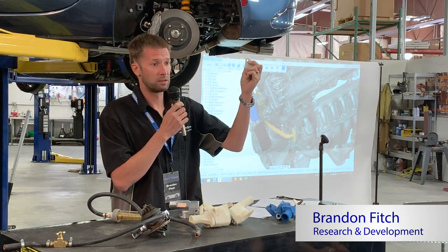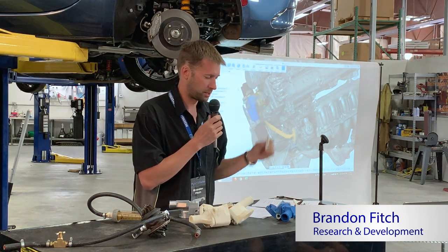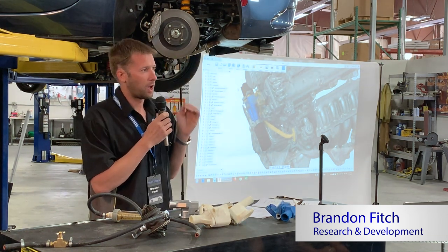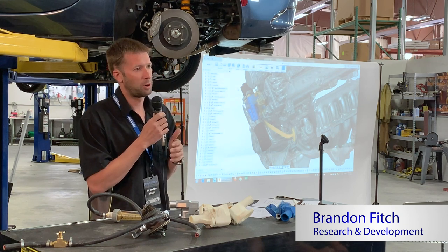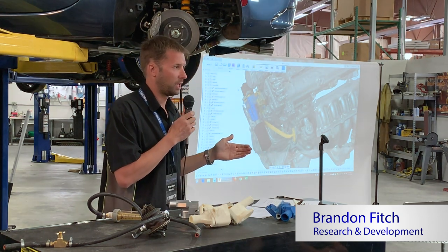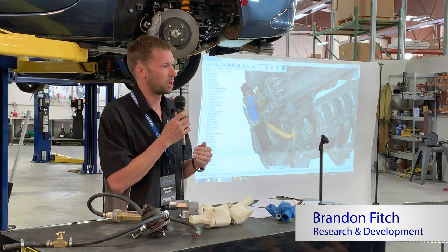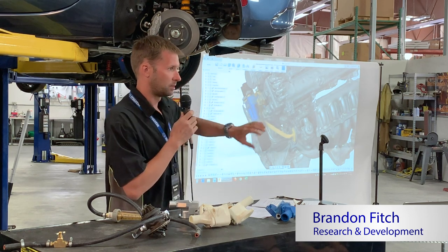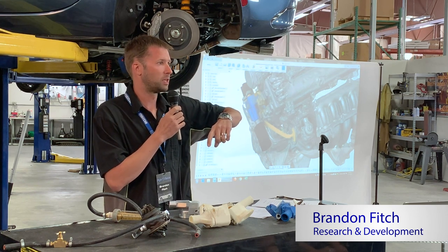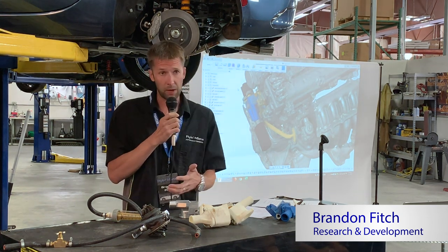And this has the thermostat neck O-ring in it. No schmutz, nothing like that, an O-ring, just like Mazda intended it, exact same dimensions, of course, Mazda O-ring. And then we also have the thermostat as close to the head as possible for the quickest possible response. The farther the thermostat gets away from the head in terms of coolant distance, the worse. If the thermostat is right in the head, awesome, that's the best possible situation. If you've got a remote thermostat that has 2 feet of hose between the thermostat and the head, that's not good. You kind of have to Band-Aid your way around getting the thermostat to react appropriately in that situation. So that was one of our goals.